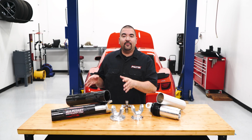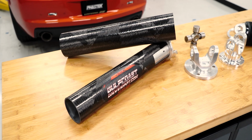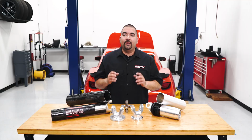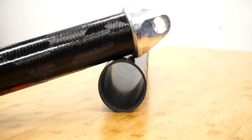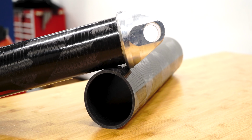The carbon fiber drive shafts are constructed of 3.25 inch by 1.55 inch carbon fiber tubing, while also using a 2024 aluminum yoke shaft. The carbon material is layered up to 14 times to achieve maximum strength for these kits. This combination is ideal for those setups that are looking to achieve high-speed runs with their builds.